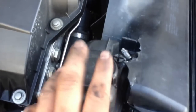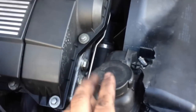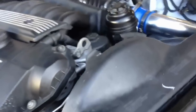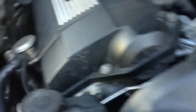This is to make sure all the air bubbles come up from the block and from the radiator, and come out of the engine and the radiator. This helps prevent your car from overheating randomly in the future.